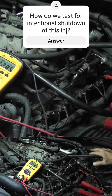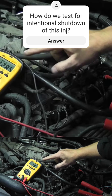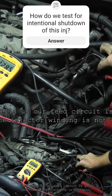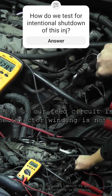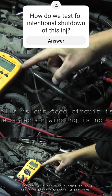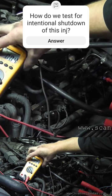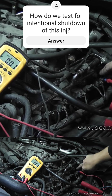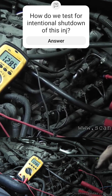Alright, next step — I have the harness plug back in and I'm reading 12.8 volts on my control wire on my fuel injector. One quick way to verify that you're on the control wire is to simply unplug the injector while you're still back probing that — see it drop to zero volts. My meter just shut off there. Plug it back in, it should go to 12. If you're on the feed wire for the injector, it would stay at 12 volts, unplugged and plugged in. See — 12.8 volts.